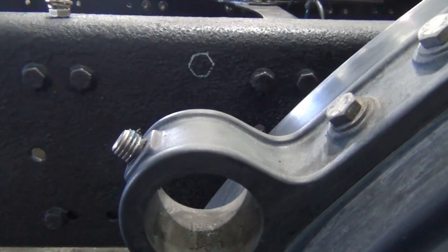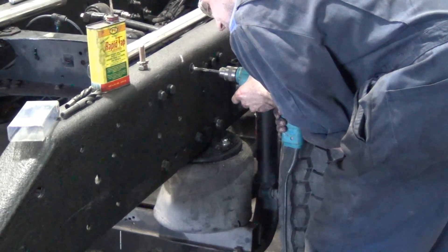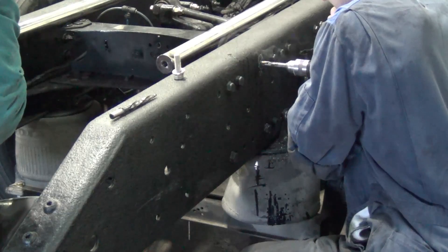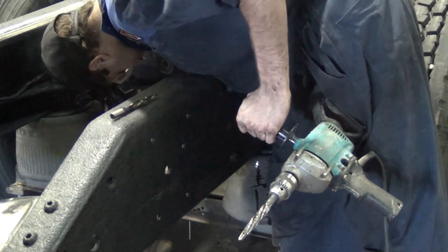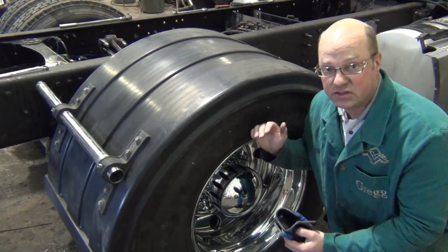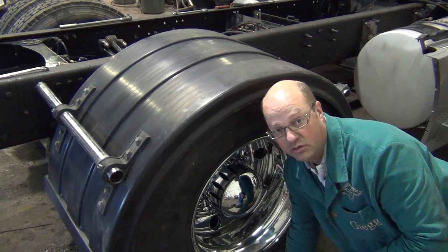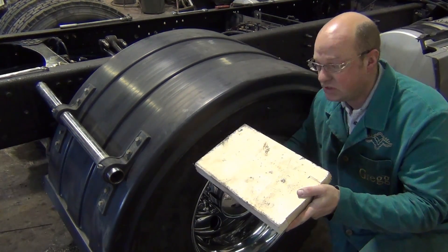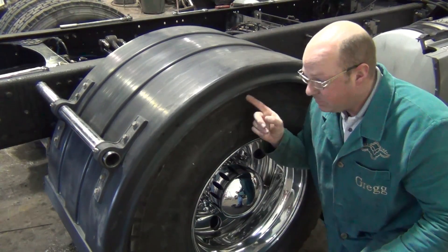You'll see that this one's been marked — we're going to put in the center of that and start drilling it. Now, the first thing to remember when you're doing your own fenders is you want to make sure that the truck is completely aired down before you put the fenders on. You want to make sure that when we run out of air, these fenders aren't going to get pushed up by the wheels. I usually use 2x12s to get the right height above the wheel. Now this truck, because it's going to Texas, I find those 2x12s work well.